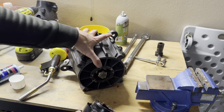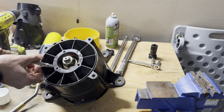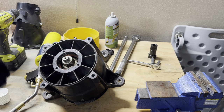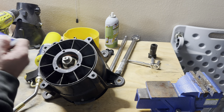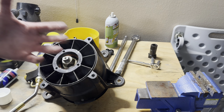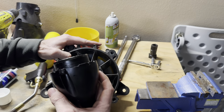So this does have a specific orientation that it needs to go in. Gotta move that hose off of my camera. There we go. We'll blow these out. Now, again, I'm one for following procedure in the manual. However, Loctite in all these holes and salt water does not work very well. Every technician that I know uses triple guard grease on the bolts for saltwater application. As long as they are torqued down correctly, you're not going to have to worry about them backing off. And if you've got a modified ski, you need to be taking your pump off, inspecting things, checking the impeller, doing a lot more maintenance anyways. And so you can go back and retorque everything just in case anything did happen to come loose. But I've yet to have anything come off, and I just use triple guard grease just like I've been told to do by so many technicians.